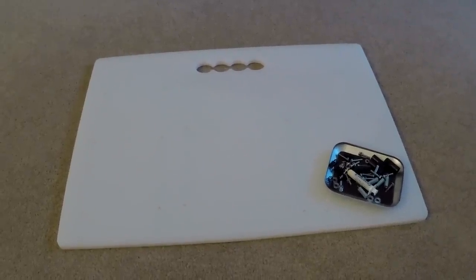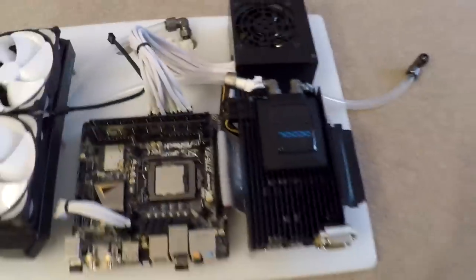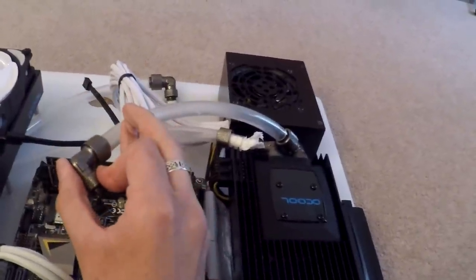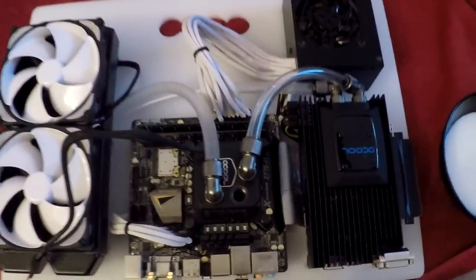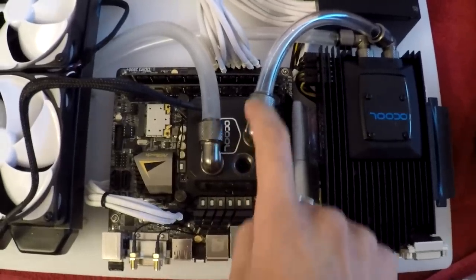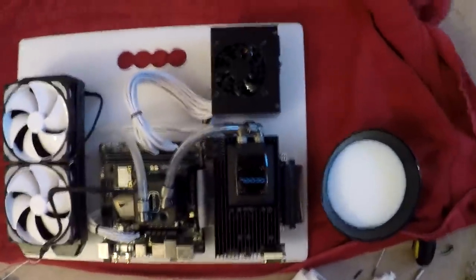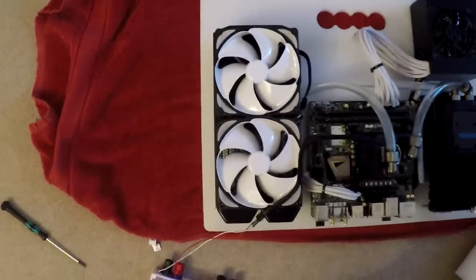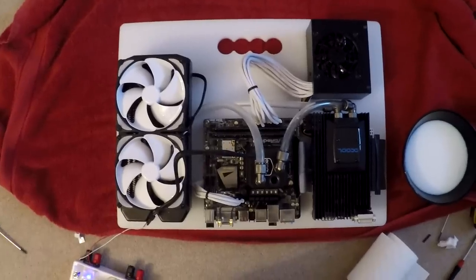The board's done and I'm putting all the hardware back on. I've decided to raise the graphics card up a bit to bring it in line with the power supply — it should look a little bit better, and this pipe won't have to come up as much either. The pump output now goes into the graphics card, which looks a lot neater. The power cable should come out down this way instead of up at the top. There's good spacing everywhere and a nice open area if I want to add any more features at a later date. Time to start filling it up again.